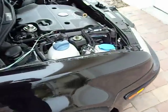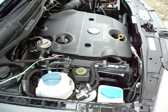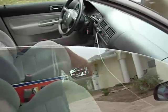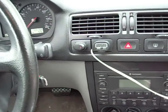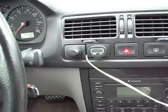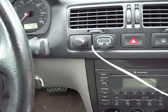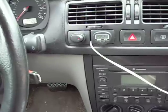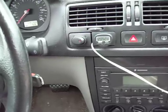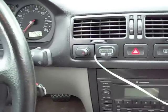Overall, this hybrid thermostat unit seems to be working really well. Normally my previous thermostat, which wasn't operating all that well, was keeping my car around 184, 186 during normal driving, and I saw it get up as high as about 204 when I was really on it. But this thermostat seems to like around 204, 205 degrees — I've seen it get as high as 209. I think my fuel economy's gonna go up as compared to my previous thermostat.